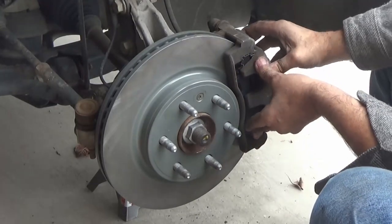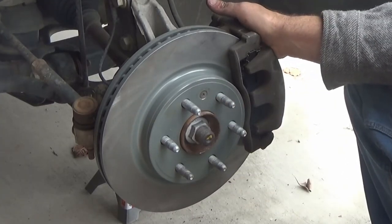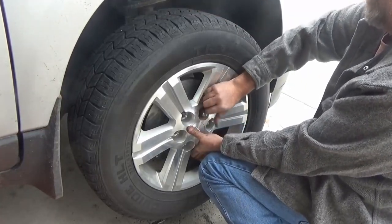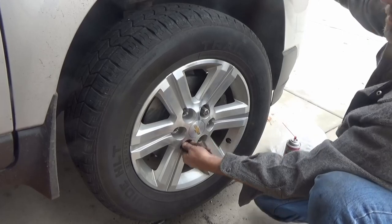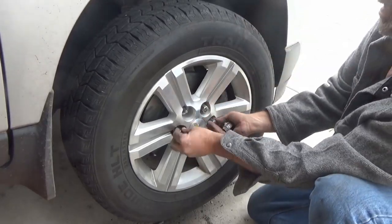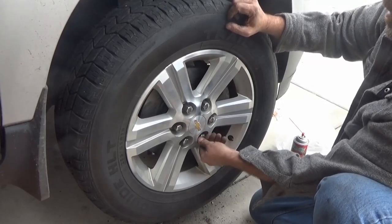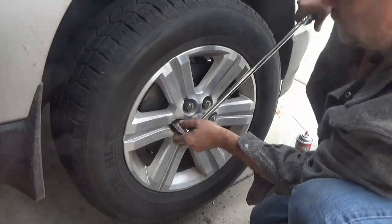At this point the brakes are done. Reinstall your wheel and tire carefully to avoid pinching your fingers. Place the wheel and hold it with one hand while screwing in one lug with the other — once one lug is in, the wheel stays on and you can start the others. Tighten the lugs in a star pattern, going across in X's until completely finished. Then take the car for a short test drive, come back, and re-torque the wheel studs.